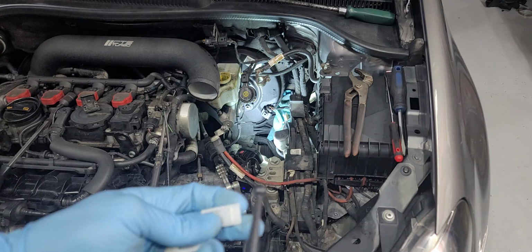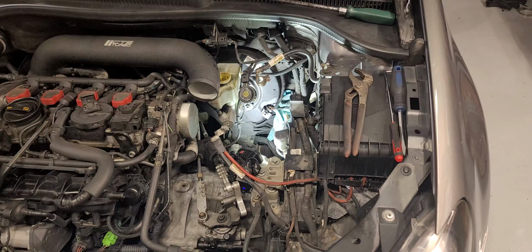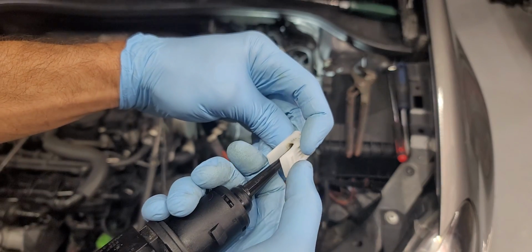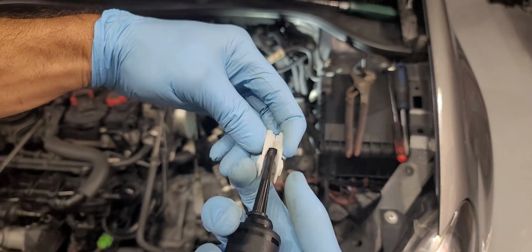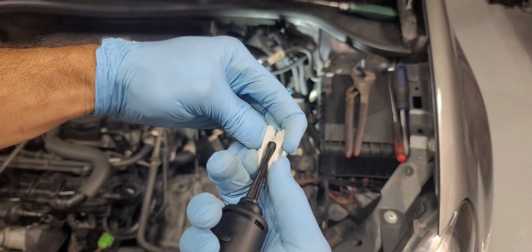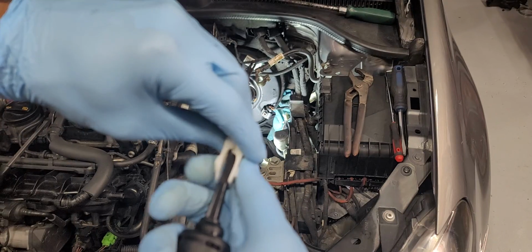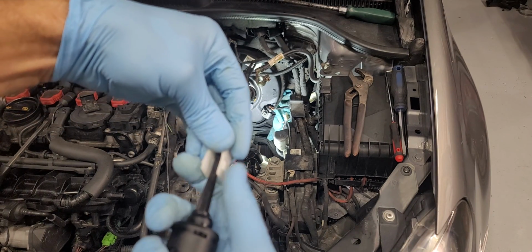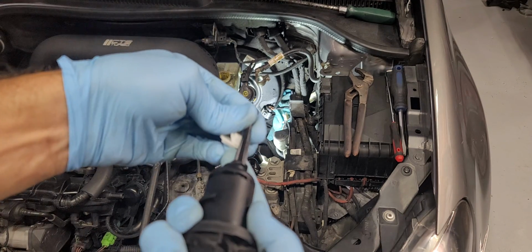that you have to remove from the pedal assembly. So on mine, because this is a 10, I guess the Mark 7s are a little bit different, but on the clutch pedal assembly, you'll see these little white rectangles on either side of the clutch, and you just need to push these in and then push them forward, and you can kind of depress the clutch pedal as you're pushing these in, and pull the clutch pedal out a little bit, and this is fully inserted here.